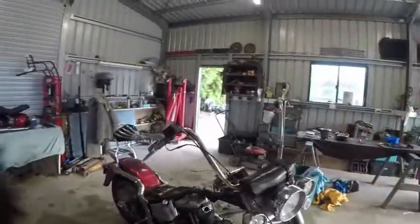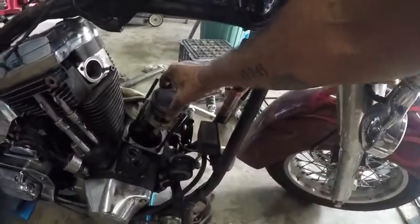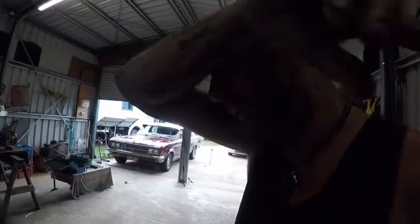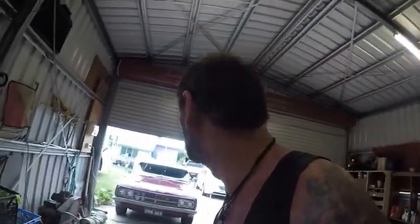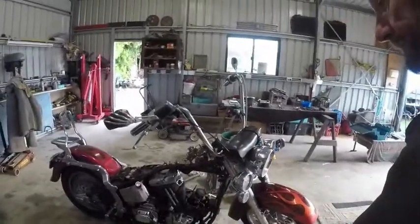That's the top end of the motor pulled down completely. The guy who diagnosed it down in Naranda was dead right - that's the bottom end bearing gone. Why this piston has so much side to side slop I have no idea, that's not normal either. This motor is basically toast. I don't know how much it would cost to rebuild the bottom end. It had adjustable pushrods marked up, so someone did actually spend some money on this bike doing the motor up at some stage, but she failed. No knees in the breeze for me for a while until I find a second hand motor. Cheers, later.